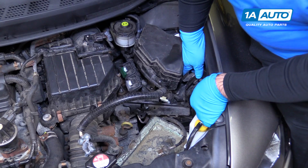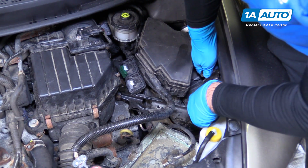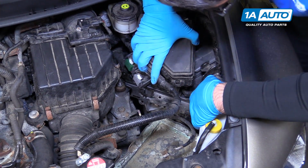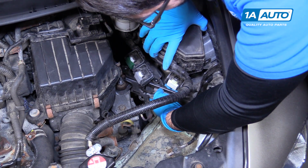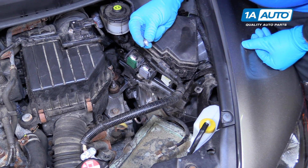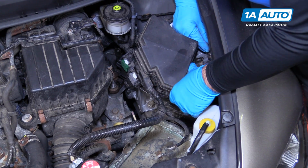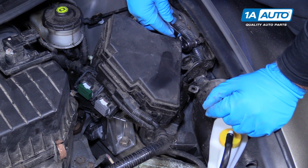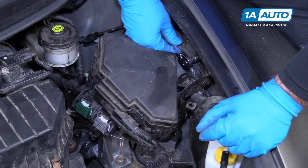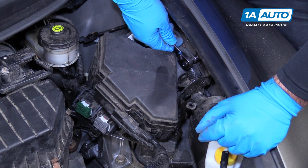This air intake tube has a little grommet that it's going to push onto, just like that. This is going to sit, move these harness connectors out of the way, and capture this bolt inside of the fender here. Snug this one down. You just have to tighten it till you feel it stop. And then a little bit more, and that'll be tight.